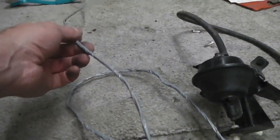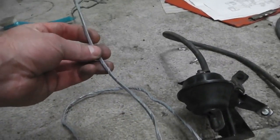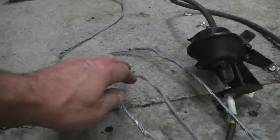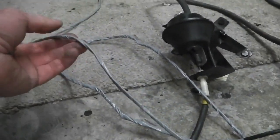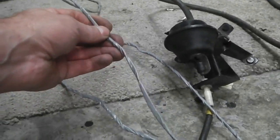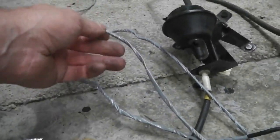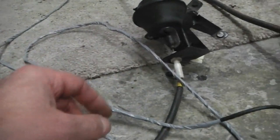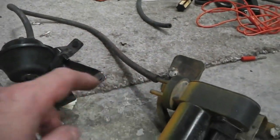Then trailing away right towards the end is the brake pedal switches, two lots. One connects to the bulbs themselves because this monitors your bulbs, or uses the bulbs as an earth signal. And the other pair are independent from the brake circuit on the Cortina and go straight back to this unit. They also incorporate the special vent switch, which dumps all the vacuum out. You use a T-piece of vacuum for that.